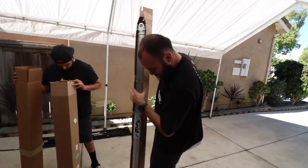With the stock two-piece it takes a lot of power to rotate that heavy piece, so with this new one we should see some power gains. Since we're pretty much maxed out on power naturally aspirated — unless we go cams, which would mean building the head — we're trying to see how we can be faster and have more response, more torque. Now it's literally just about making the car as light as possible and making all the rotating parts lighter. The next piece to the puzzle would be a lightweight driveshaft.